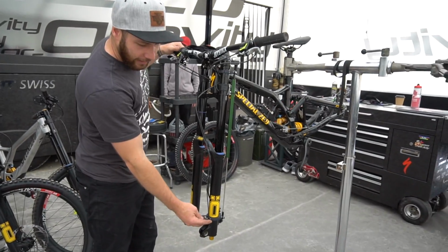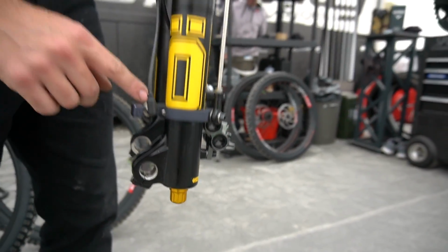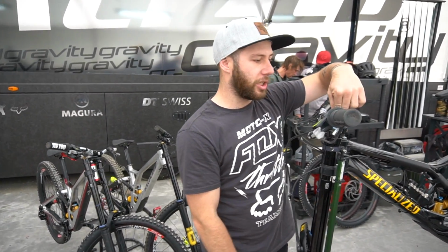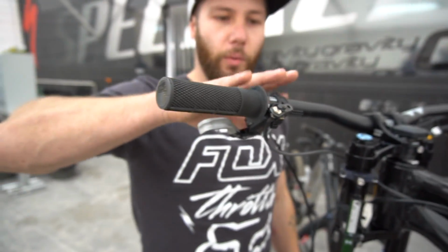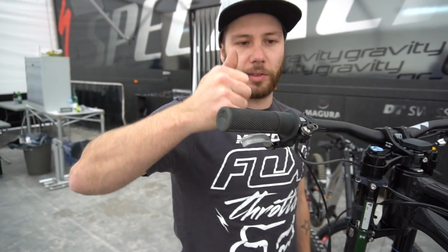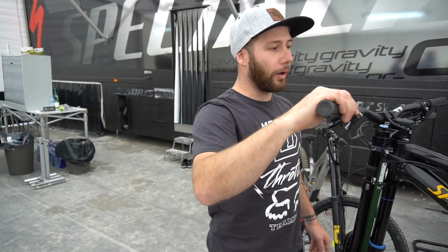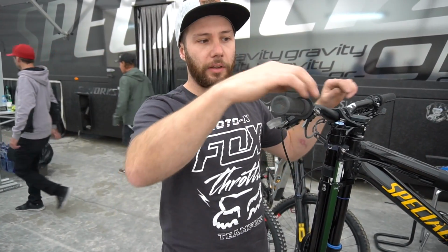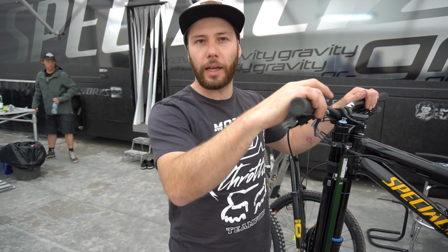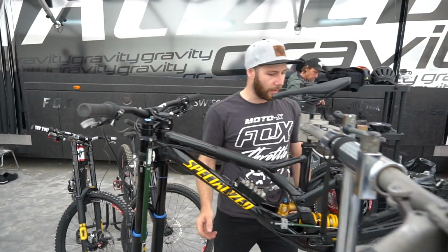I know. So here is the speed sensor. You have one in the front, one in the back. Right there you have the GPS. Here it's like a trigger, so anytime we want to do a split or information point, Finn just has to press on that and give me a cross on my computer, and then I can notice where it is. It could be something good or something wrong. If the bike reacts good or not, we can have that information through that point. And we also use that for split time, which is interesting. And yeah, that's basically what we get.